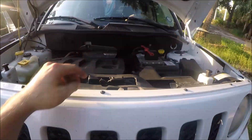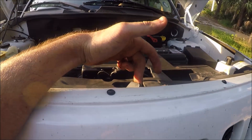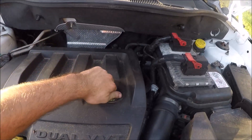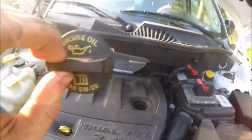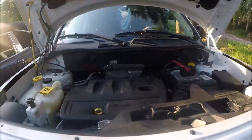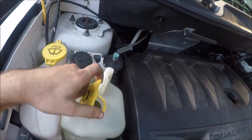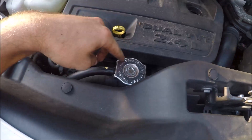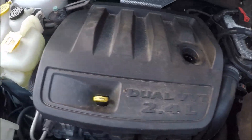The first thing we're going to do is open up the hood. There's a little latch under the hood right here, so once you pop it, you can just put your finger in and push it on up. We're going to come over here and unscrew the cap for the oil — make sure you don't lose that. Now is also a good time to check everything else: make sure your coolant is okay, wipe your power steering fluid, check your radiator, and make sure all your belts, hoses, and everything else look okay.